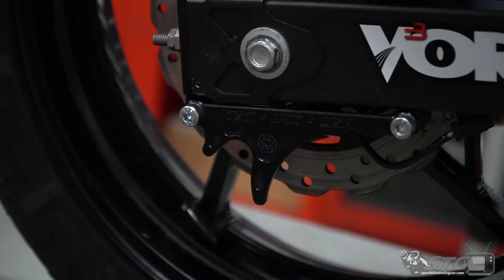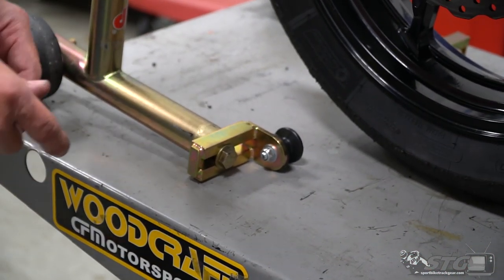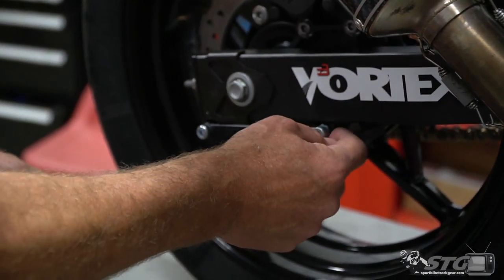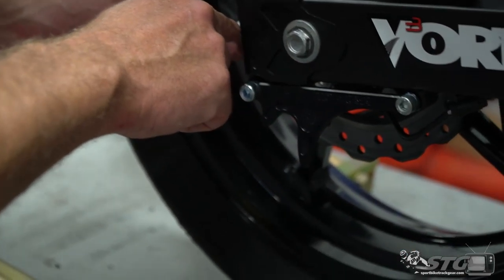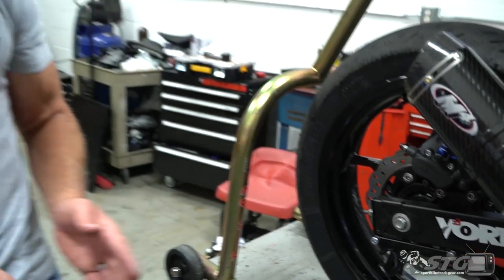The new caps have longer shoulders and then bolt to this GP lifter. So you need a GP style rear stand — we're showing a Pitbull rear stand here with GP supports. This bracket extends all the way to the swing arm spool boss and bolts there. You've got your spring that's holding the chain adjuster in place. I'm going to show you what it takes to install it, and I'm going to show you a rear wheel change after having that in place. If you've already changed the tire on the Ninja 400, you're going to see it was a whole lot easier.